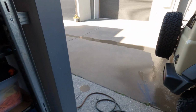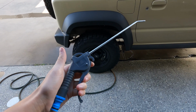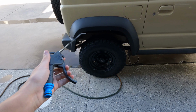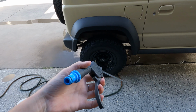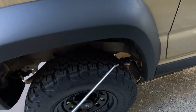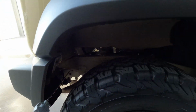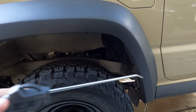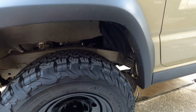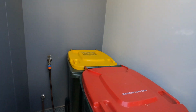And the next tool that I'm going to show you is from Osito. Just can't remember the exact name for it, but I'll put it in the description. And this is a genius tool when you need to get into those small holes around your chassis. So this is where a lot of people sort of overlook when it comes to cleaning, but it's like the most important things you have to do with your chassis, because you'll see in here you have heaps of small holes, and if you don't clean that out and the sand and the salt sort of puts itself and lays at the bottom of the chassis, and you never actually flush that out, that's when your chassis is going to corrode and it's going to cause a lot of troubles. And just going to turn this off.